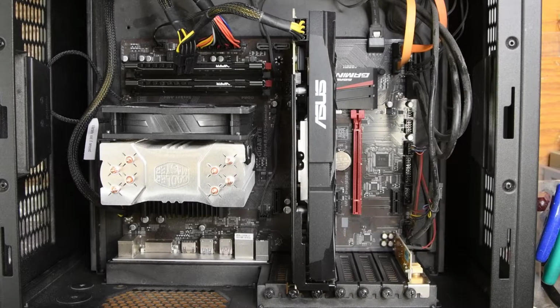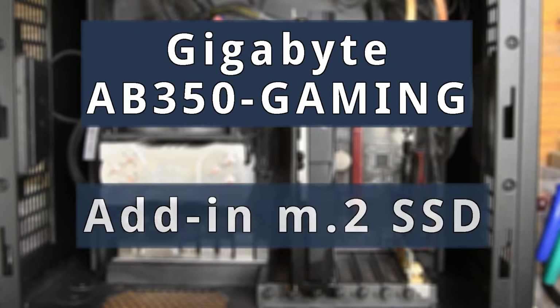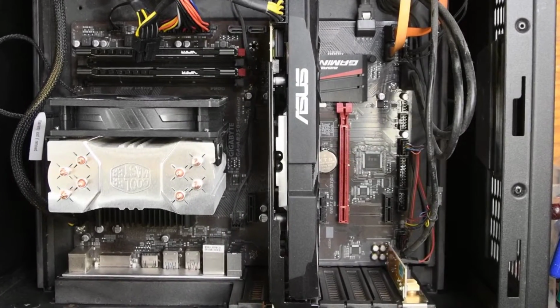I'm needing a bit more fast storage. The only thing is, this motherboard only has one M.2 slot, tucked away right under the video card. I have a WD Black SN750, 1TB in it at the moment, and with the price of the 2TB drives dropping so low, the most practical thing would be to just replace the 1TB with a 2.